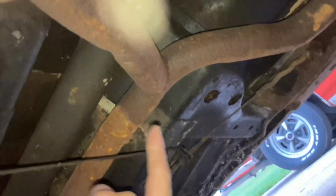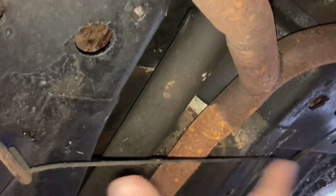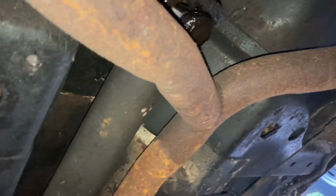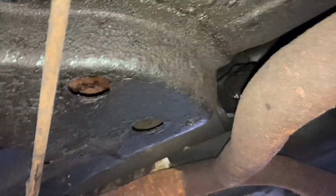And the other thing is when doing the floor pan, if you're putting these pieces in, my car is missing the X brace. I will probably purchase one, but go ahead and mount that loosely as you're putting it together. That way, the most important part when you're done, these 6 bolt holes that brace mounts to, well, they got to line up. That's probably the most critical thing when it comes down to getting things right. But like I said, I'll get you the measurement from front to back. That way you can get these things set up right.